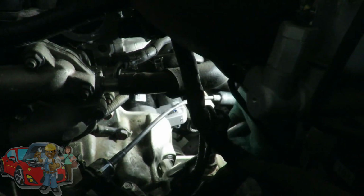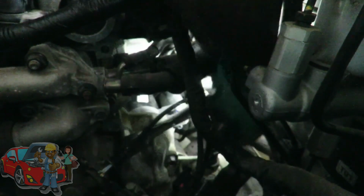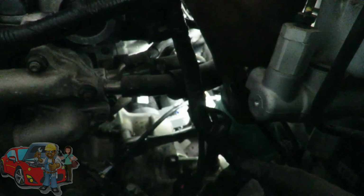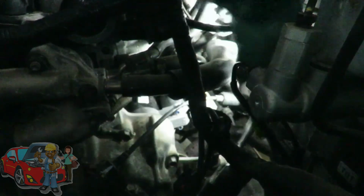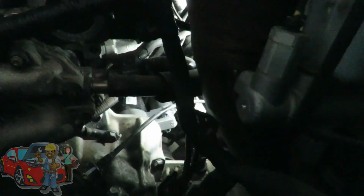That's it. It's going into the alternator. Alternator is aluminum. The alternator? I mean the starter. And you don't want to strip that bolt out. So just go ahead till you feel a tension on it to stop, and then a little bit more. That is, dang it. Then drop your ratchet. What's that? Dang it.